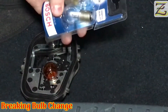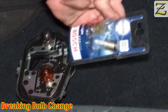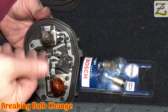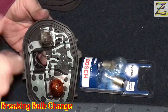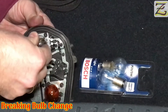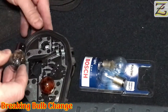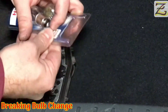According to the manual, the bulbs you're going to need are P21 5W — 5 watts, P21. As you can see, there are two bulbs in here. It doesn't matter if you touch the bulb with your hands because these ones don't get too hot, so there's no danger. The thing you're going to do is push it downwards — there's a little spring underneath it — push it downwards, turn it anticlockwise, and the bulb is out. Take the damaged one and put it aside.